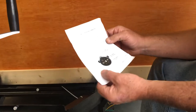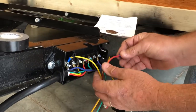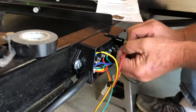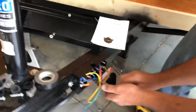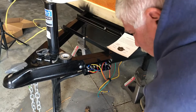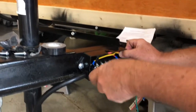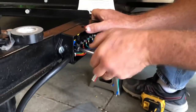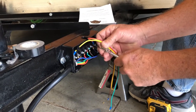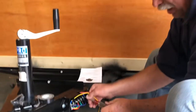Your trailer brake is blue — it's the hot for the trailer brakes. But I'm using red wire going back to the brakes. They don't know what colors are coming back, just so you have them correct. Have your little nut drivers — the best things to use on this — run them up there and snug them up. If you get in your vehicle and plug that seven pin right now, your trailer brakes work, if you've got a brake actuator on your vehicle.